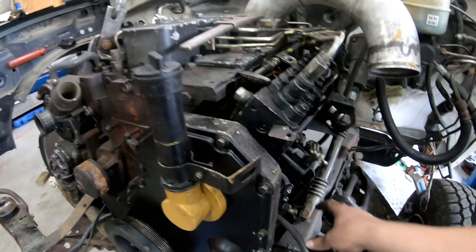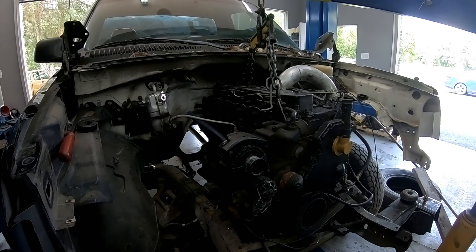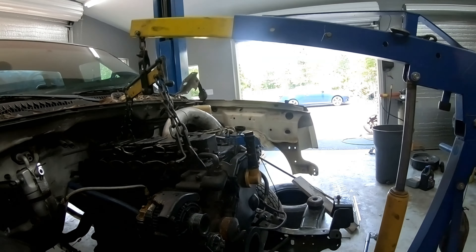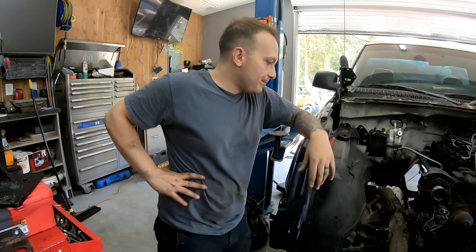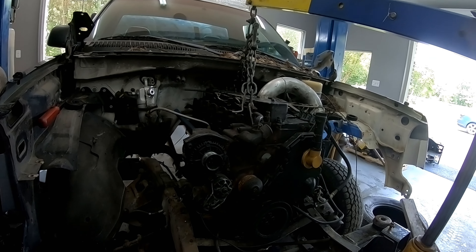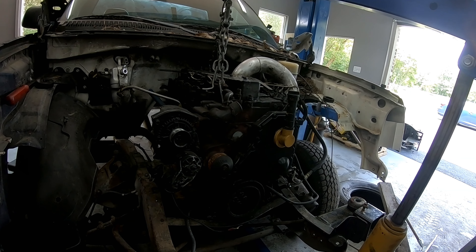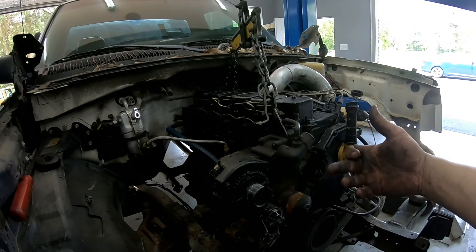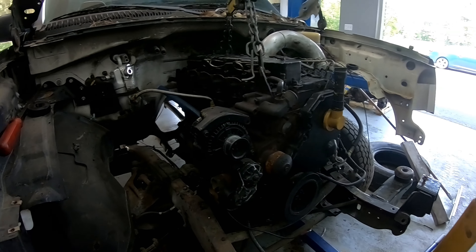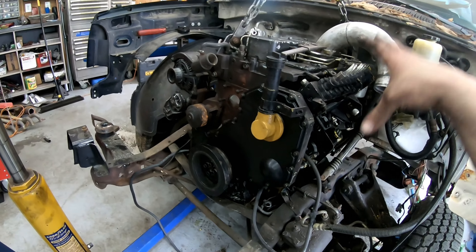Alright, so we have figured out some things — mainly that it's going to fit. We got a spot where it looks semi-level. We need to figure out how we're going to center and level the motor in the frame. I haven't really figured that out — we need to look up what kind of drivetrain angle we need to put in this bad boy, because it's going to need a bit of a drivetrain angle. We have to go off the frame, not the cab.